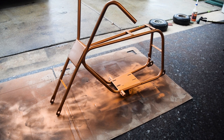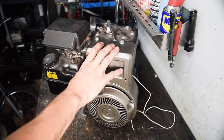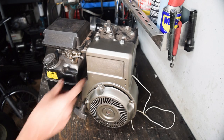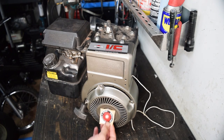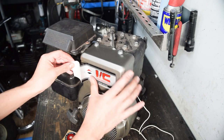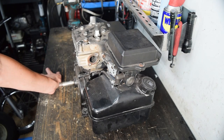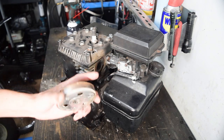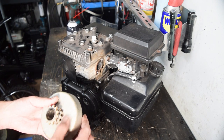I was painting outside and then it started to rain and now we're just sitting here. Here's the engine. We're going to go ahead and pull the carburetor and gas tank assembly off because we're not using this style. I did go ahead and take this side cover off to paint it so that it would match the graphite I used for the accents of the bike. But in doing so I had to take the sticker off and unfortunately I don't have a new one that says five horse — I only have one that just says the general label, so I'll throw that on there. The engine is a 95 so it already came with the electronic ignition style coil, otherwise I would have converted to that.